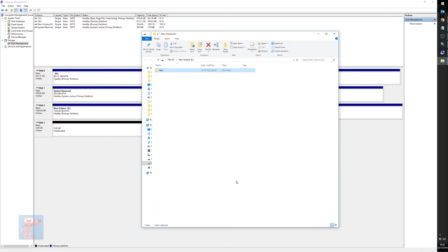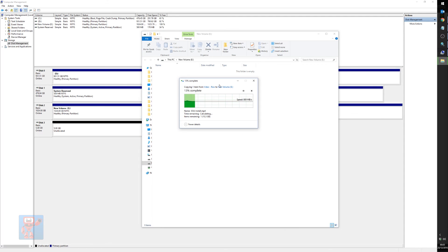It's probably also worth having a very quick look at the performance on this. If we start copying that same file from earlier, you'll notice this really interesting thing — it peaks massively around a gigabyte per second to start with before it settles down to the correct speed. I believe this is where Windows is doing a bunch of caching before it figures out what speed it's actually running at and misreports for the file copy. But we're settled into a slightly quicker speed than we had before, with these weird dips where something happens before it goes back up. I'm going to do a separate video after this looking at the performance and how to stabilize it, because theoretically iSCSI is a faster option — we certainly get higher peaks, but there are these weird dips that we need to look at.